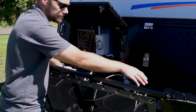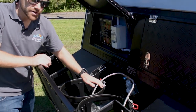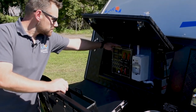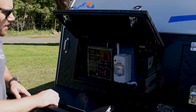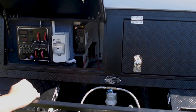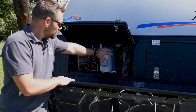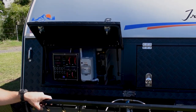Forward on the front of the camper you've got two jerry can holders - two 20-litre jerry can holders - and two nine-kilo gas bottle holders. Both of them are plumbed in, all certified in Australia, with the regulator built in so that runs through to the camper, through to the kitchen area, to your hot water system and so on. In here is your control box for your batteries - all resettable breaker switches and fuses, your main isolators. You've got two 100-amp batteries, so that's 200 amp hours of battery power total. It'd be very rare that you'd run out, especially using solar panels to keep things charged. You've also got a 2000-watt inverter and a 30-amp battery charger that runs off the 240-volt system built into this camper trailer.